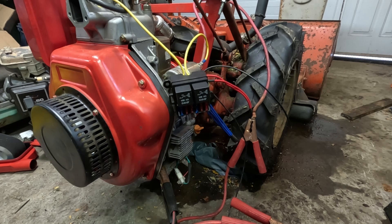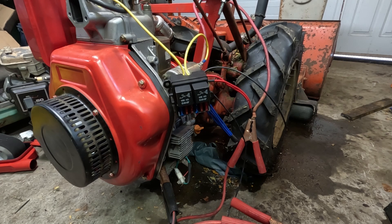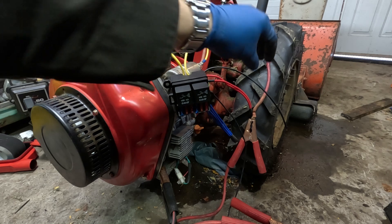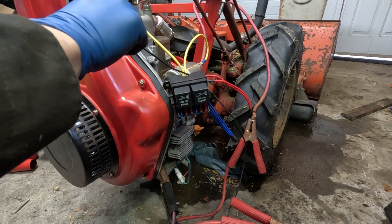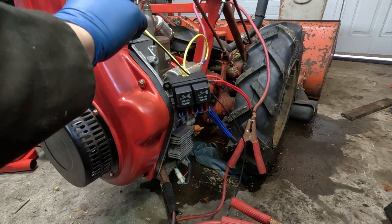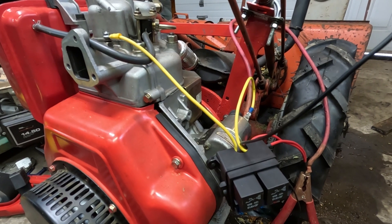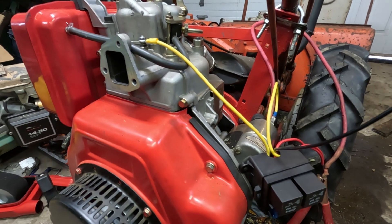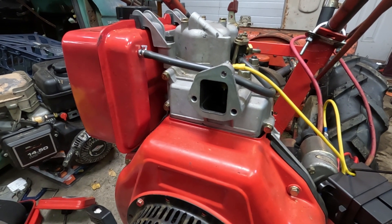Let's give the starter a little click over — it's basically the same thing but we're using a different signal wire. I don't want this thing to start, so if it just turns over I'm going to be happy. The fuel is turned off and it is in the shutoff position on the injection pump — just if it spins over at all, I'll be happy. And there we go — looks like we got success. Our electrical system is a success: we got starter, we got glow plug, we got the thing indoors, and we got the Diesel 911 in there.